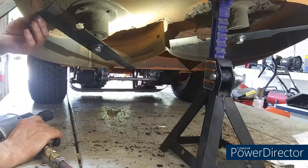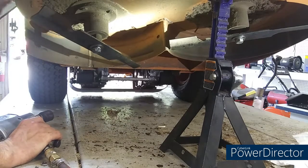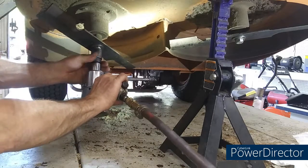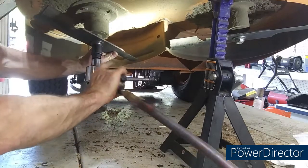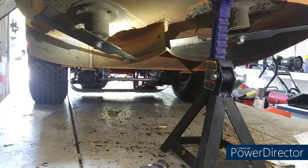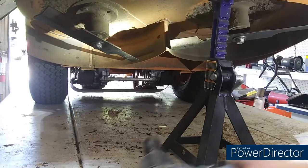Take the nicer of the two blades, the best looking blade, and I always put it right where the chute is, because the customer is going to walk up, open the chute, and go, yeah, that's a pretty blade, that's a good job sharpened. Little trick for you. If one of them's got a nasty gash or something in it, you don't want to grind it to nothing. Put it on this side and put the nicer one on that side. He'll see that side.